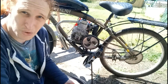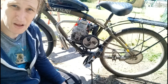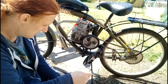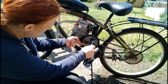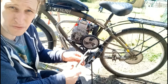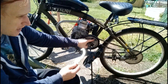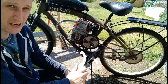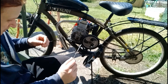The tool we need to put on a new belt is a five mil allen key because there are four bolts behind the wheel. You might just have to rotate that wheel around to get to all four — not rocket science. We loosen those four because that's our tensioning key. Now there are notches in and around this plate. Basically you just hook that in there and pull it back to tighten it. You can do it by hand, but it is a fair bit harder.